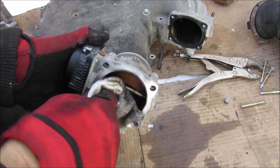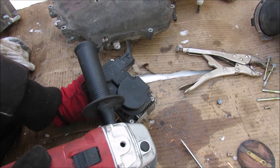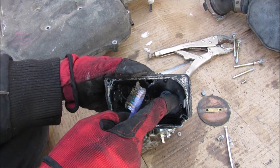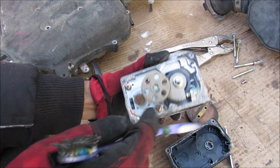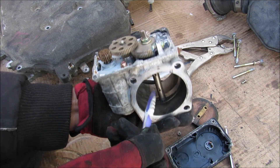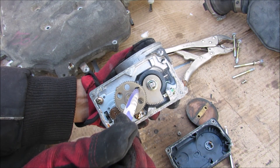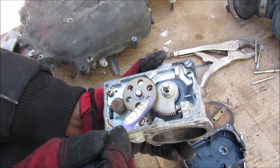I'm going to start disassembly by removing these two Phillips screws and sliding the butterfly valve out. The throttle body has two components — the casing, which houses the throttle position sensor, and I can turn the throttle position sensor 90 degrees in accordance with how the butterfly valve would be positioned inside the housing. We've also got two electrical connectors which connect to the motor on the throttle body assembly. The gear train reduces the gear ratio significantly, allowing very precise positioning of the throttle. At the bottom is the pinion gear connected to the motor, then an intermediate gear, and then a 90-degree gear correlating to the 90 degrees the throttle plate needs to move from minimum to maximum wide open throttle. Although this is drive-by-wire, there's also an adjustment screw which adjusts the stopper and the final resting position of the cam and butterfly valve at idle.